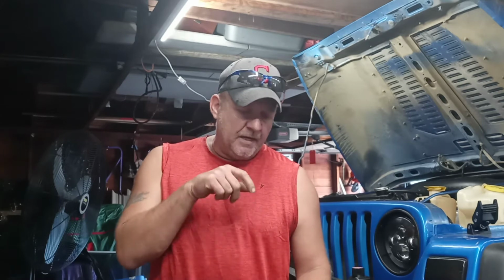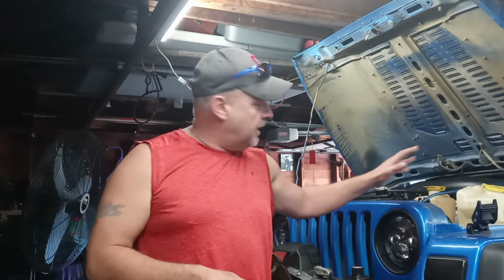What I did was, where that distributor gear goes in, I went in there with the drill and a flat bit, like a spade bit, and got it on that drive gear, that oil pump, and just spun it slow. It pumps up really quick when you're doing it that way. And then I went back and did it with a ratchet just to double check, to make sure all my oil galleries on my rocker arms are getting good oil and everything.